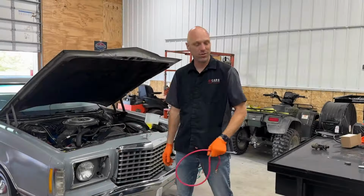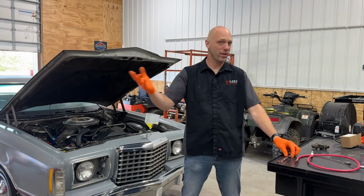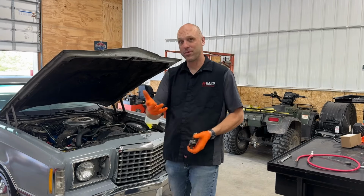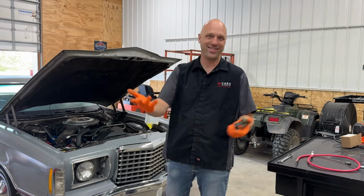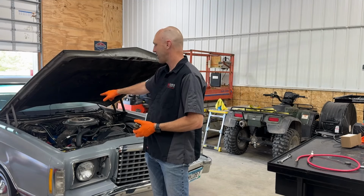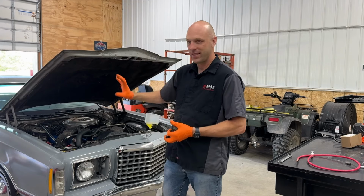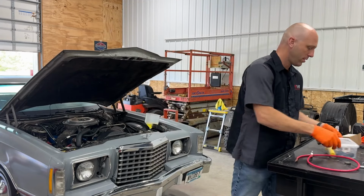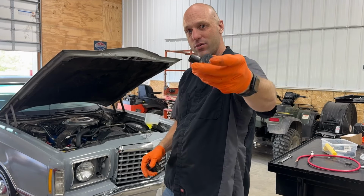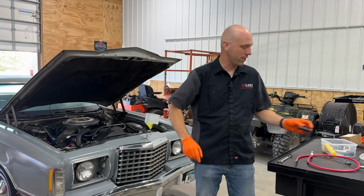I forgot to tell you something. I wasn't withholding information on purpose, I just didn't remember that I was. I took the heater control valve out of the heater line to put in the T-fitting adapter, something like this, so I can hook a hose and get all of the stuff flushed out of the system.